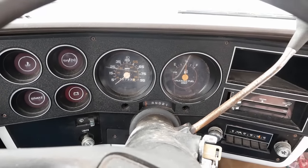So right now the throttle is actually being held open slightly by this high idle cam. As soon as the engine starts, it starts to make vacuum. It pulls in this little vacuum pot back here. That's your choke pull off, and it opens the choke slightly. It won't keep running if the choke's fully closed. So as soon as it starts, it opens the choke just a little bit. It also now has 12 volt power coming into the electric choke. There's a heating element here. That heating element starts to heat up the bimetallic spring inside here, and it's going to slowly release its tension